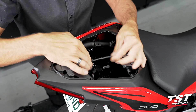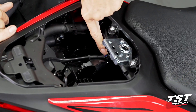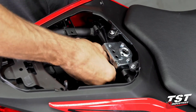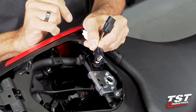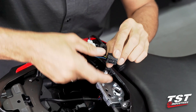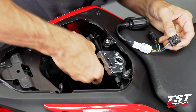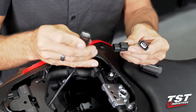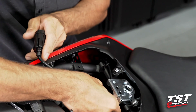Here is the wiring from the taillight going into the harness connector — it's right below here, hung on the frame on a little tab. It's more troublesome to remove it from the tab, so I'll just perform the modification blind in here. The locking mechanism is facing down — we need to reach around with a forefinger and press on this to release it from the mating connector. Then we mate the taillight connector into our intermediate sub harness on our brake light modulator and plug that through.